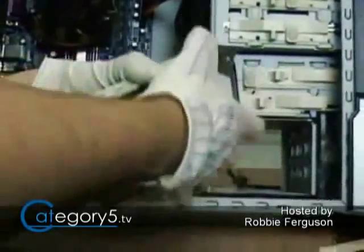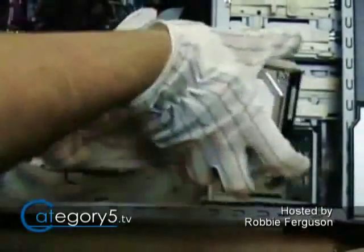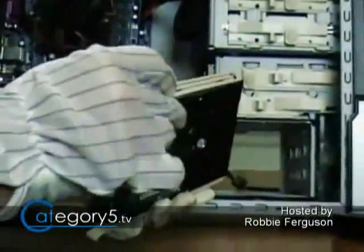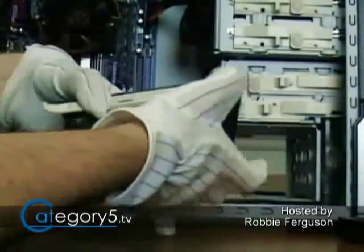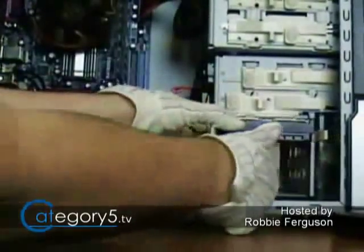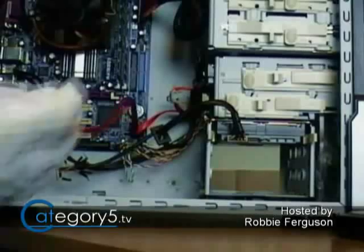The positive I think outweighs the negative because the nice thing about having a parity drive as opposed to striping is power consumption. Let's say you've got six disks in your array — your parity drive and five data disks. If the data on the first three disks is being used, the last two disks can actually be powered down. Unraid is going to turn those off, which extends the life of your drives and conserves power.